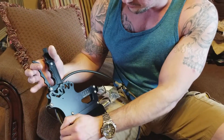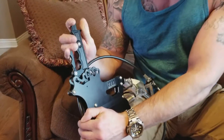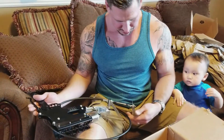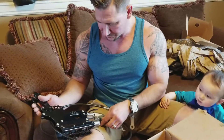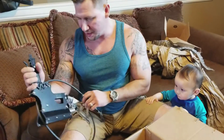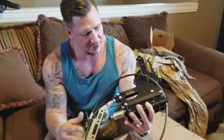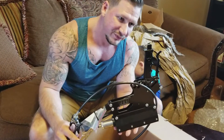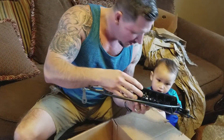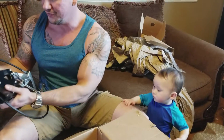This is for a Turbo 400 with a reverse manual valve body — not neutral safe. This is going to be a shorter shifter cable. The one I had was a front exit cable; this one's a reverse exit, so I'll have to change that up. I'm probably going to mount it a little sideways. I know there's not a lot of these online as far as pictures of it. Really nice — it's light, and you can see how it's all cut just for lightweight.